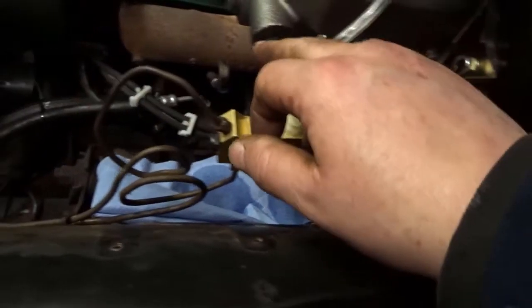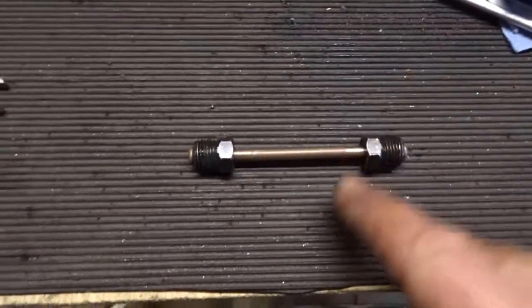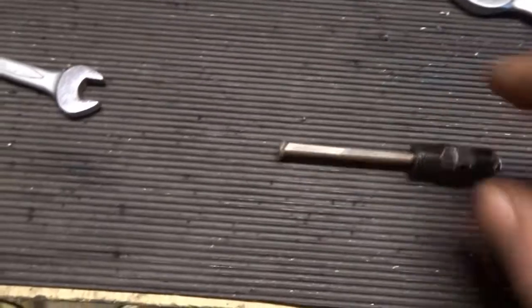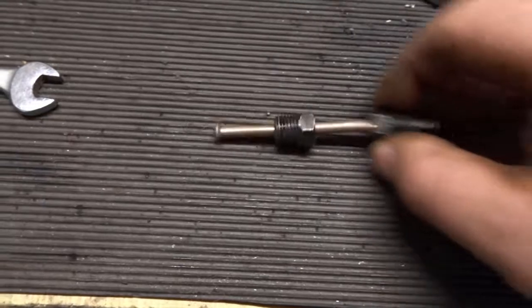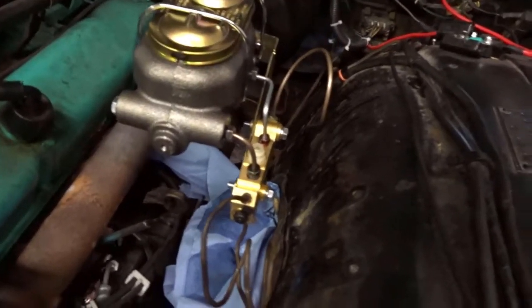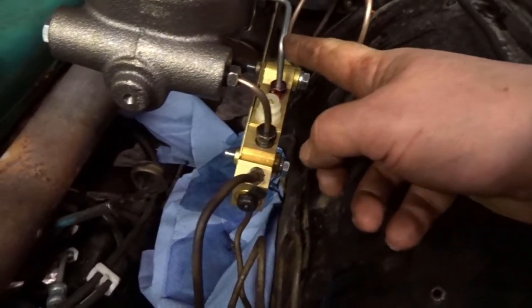I think these are made of steel which means they don't bend very easily. I got that one in and then found the one that was supplied was too long. Top tip: put your fittings on first. If you're making a short link, put your fittings on first so you can slide them all the way up to put this flare on, and then all the way the other way to put this flare on. If you put the bend in first you can't get these out of the way enough to get it through the flaring tool at the correct length. It actually took me three attempts to get this the right length, otherwise I was over-stressing this one.